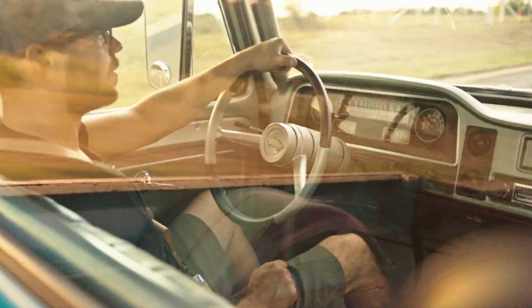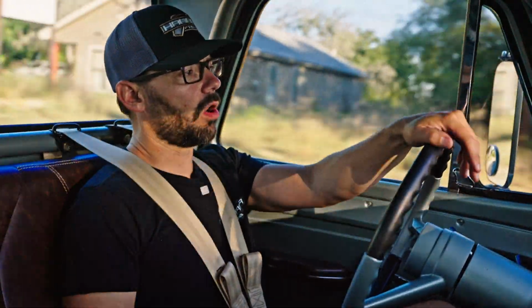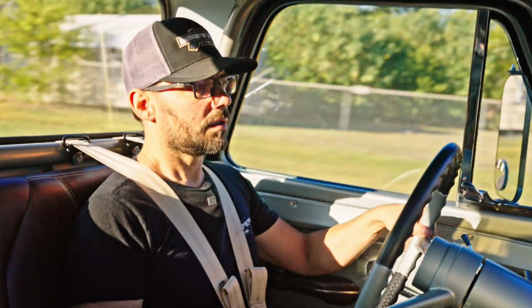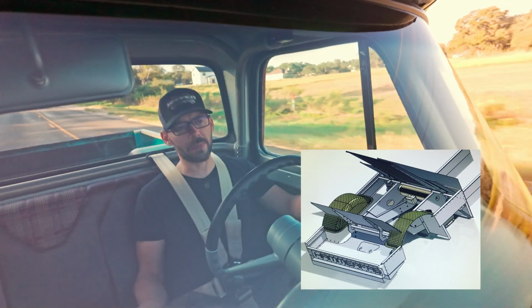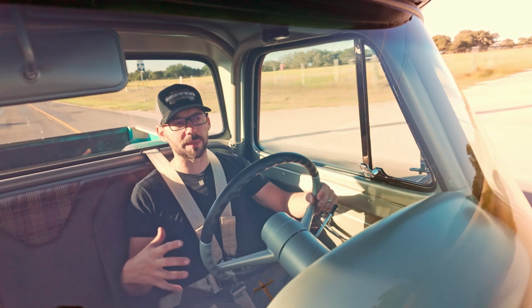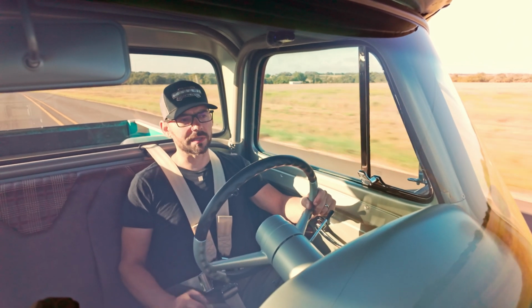Whenever you build a truck that sits as low as this one does with all the air ride stuff, and the batteries are in the back now because there's no room for them up front, you got to be able to service that stuff somehow. So my goal with this build was to design the bed floor in such a way that wasn't like everybody else's. So instead of using 1x1 square tube structure, which I don't like, we decided to design the whole bed inner structure in SolidWorks. We had all the pieces laser cut, CNC bent, and basically it's kind of like a modular, every part bolted together becomes a strong unit in and of itself. And so what we ended up with was two flaps, or two bed floors, that tilt up instead of one big bed floor.